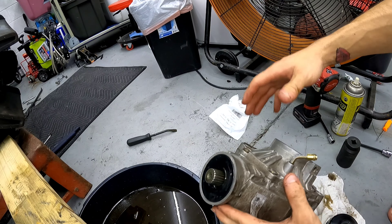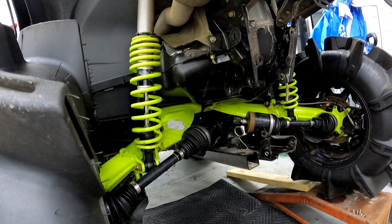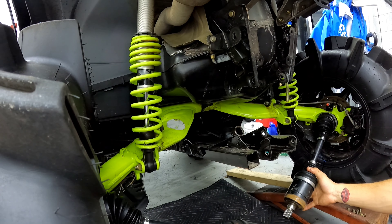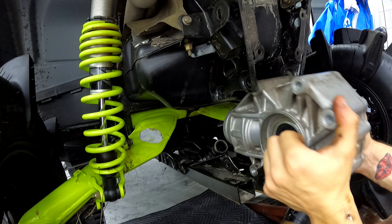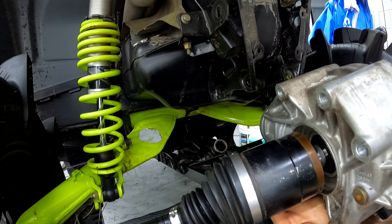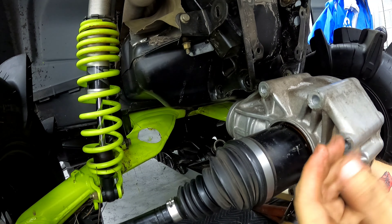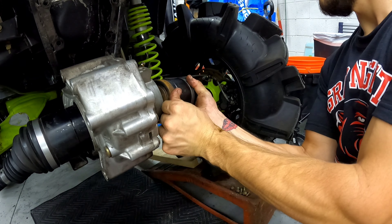That's it — all I gotta do is put this back in the four wheeler. Now I'll show you the quickest way to put it back in after you've done the repairs. What you want to do is put these axles down. To get the differential back in, put the differential right here, put one side in first. Amazing — now we got one side on, and now with it leaning backwards we're gonna put on this other side. This side slides right in as well — boom.